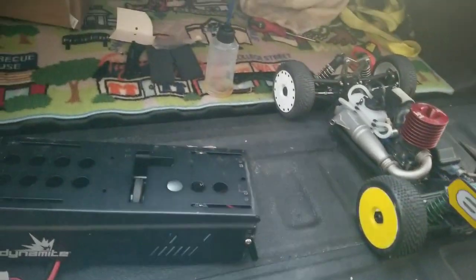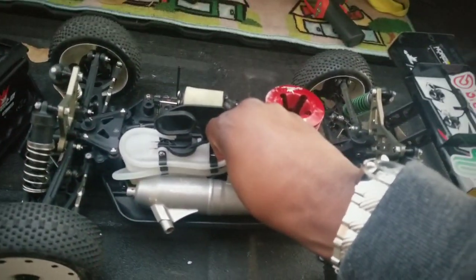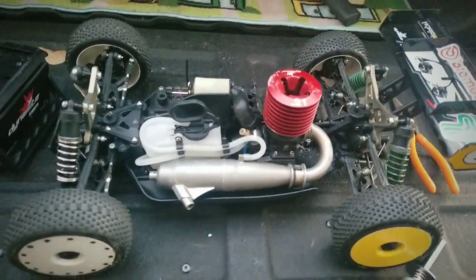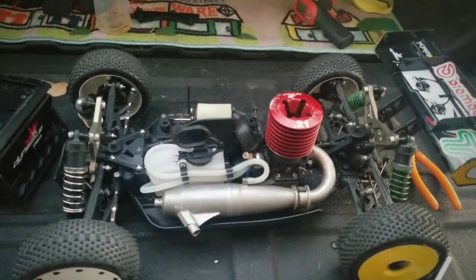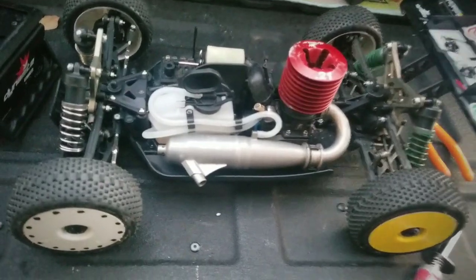But yeah, because I'll tell you what, it's a lot easier now. I'm not gonna lie. But you got to let me turn this off. That's how you know when your engine is not too lean on your low end idle. If you pinch your gas and you don't hear it idling up just a little bit before it turns off, it's too lean. So turn your low speed idle. Just switching it up a little bit. Anyway, you see that there?